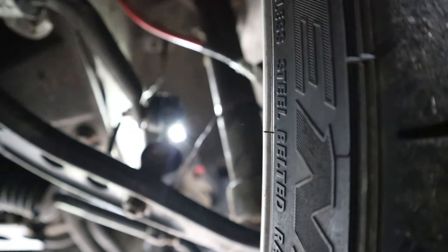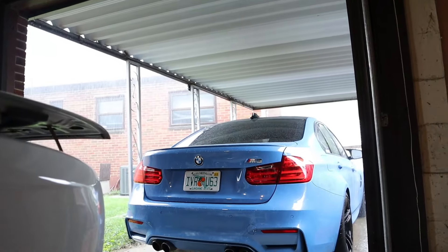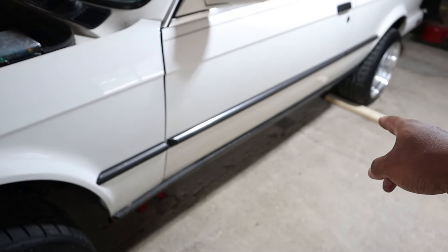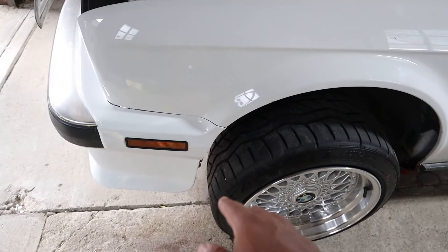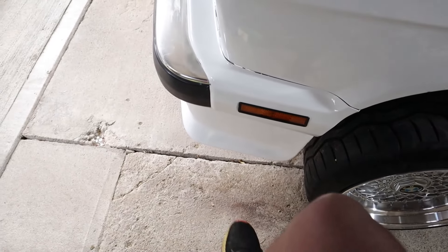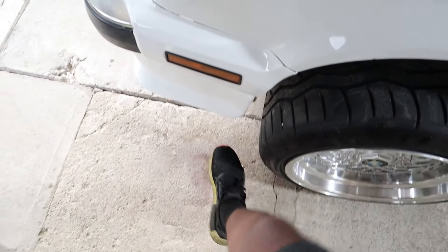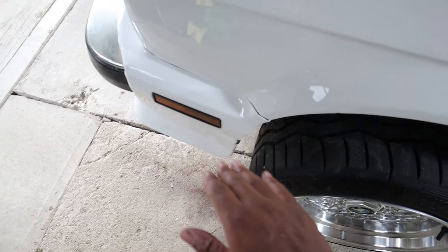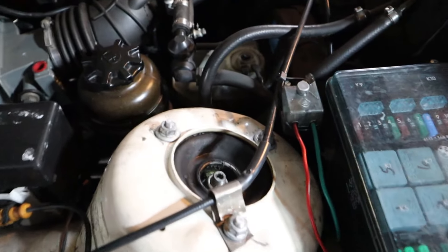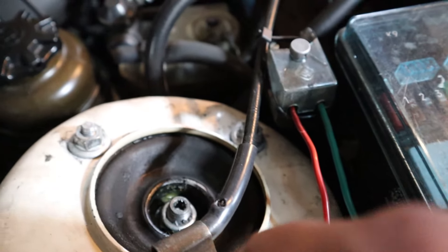I think that's the source of my noise right there. If you've got some extra wood laying around, what you could do is make a kind of pump — you put the wood under there and press down, essentially bouncing the wheel up and down with just your foot. You put a little pry bar under there and that will allow you to check your mounts from up here as well. You just want to check for damage and make sure nothing is bouncing around too much.